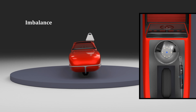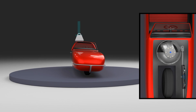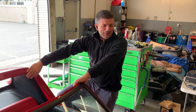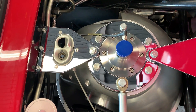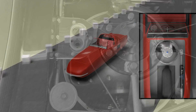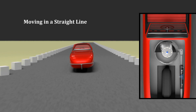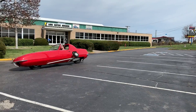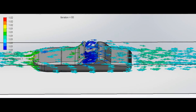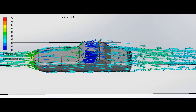Additionally, there are many conditions where the imbalance is continuous, like a continuous side wind. Here, it is demonstrated that because of a force acting on either side where the force remains, a new point of balance is established, and the flywheel assumes a position of constant precession. The vehicle is now moving in a straight line, which is similar to that of standing still. The gyro must make continuous corrections to keep the vehicle in balance. In addition, the aerodynamics of the vehicle as well as the front wheel geometry play an important role in the stabilization of the vehicle when in motion.